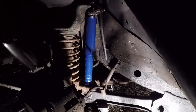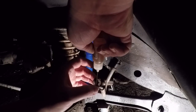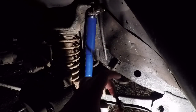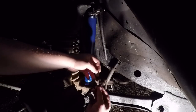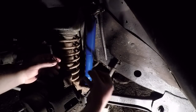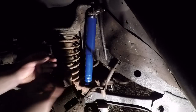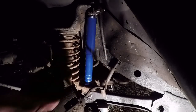All right, before we fully tighten it down, we wanna get the last two bolts in the bottom. So we're gonna take our old bolts because it did not come with new ones. Gonna put some more diamond lube on the bolts because they are rusted. So I wanna make sure they go in there smooth and it'll help prevent rusting too, since they are old. Probably should paint them too, but whatever, that's fine. So it's hard to see, I know, but let's get this top one off. We'll just pop it through here like that. And then we'll put these two together and get them on.